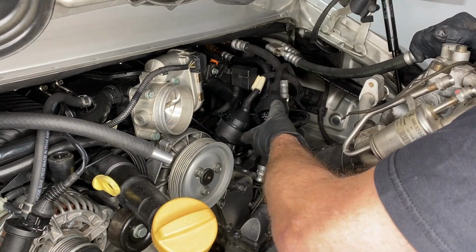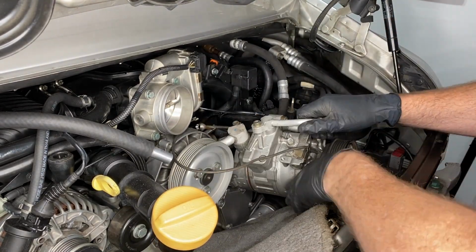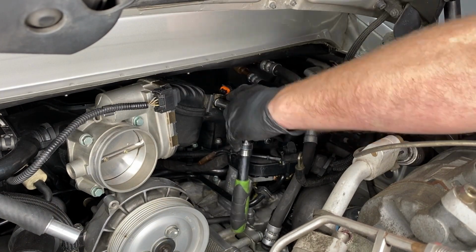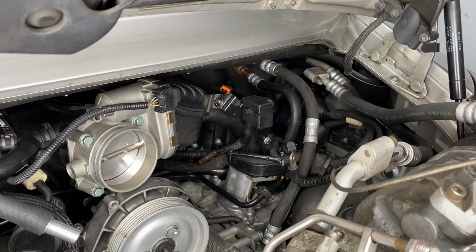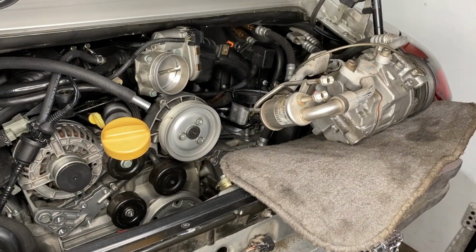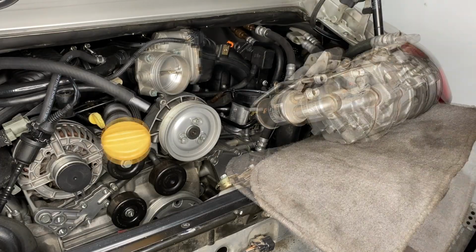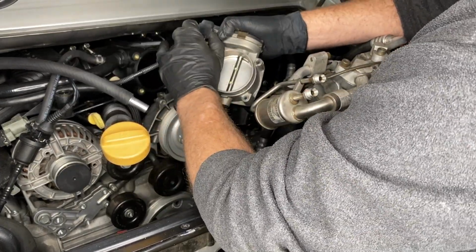To start with, I'm just gonna kind of fling it in there and see what happens. I took out that vacuum line for now so I don't mangle it. It's going to be pretty easy to put back on later. I'm moving that B plus junction box just to give me a bit more space. I'd like to move that wiring bracket, but we'll leave it in for now. In order to get more access to those fuel lines with my huge hands, I think we're going to have to regress to make progress and take off that throttle body.